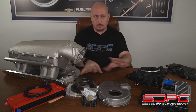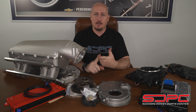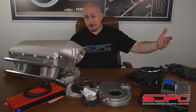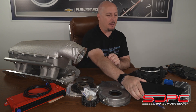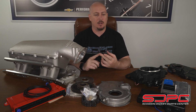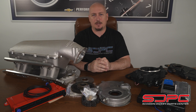Now you're probably wondering about the rest of the fuel injection setup. You can use a Holley Terminator, Terminator X, Dominator, or anything along those lines. These are nice because you can set the parameters without dealing with OEM nannies or emissions-related restrictions. On the more straightforward end, you can keep your stock-style carburetor intake plenum and go with something like a TBI system. This Holley setup is nice because you just bolt it on — it has the flying lead, the harness, and everything you need.